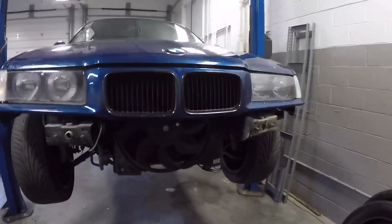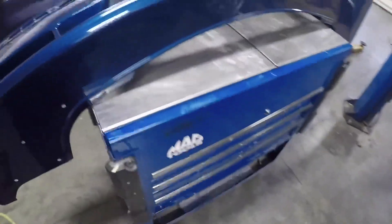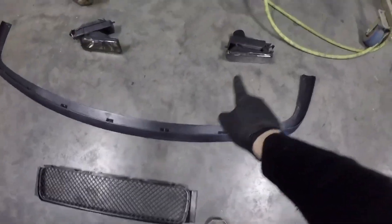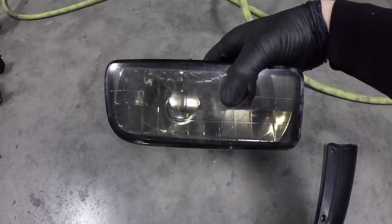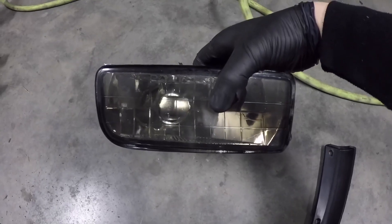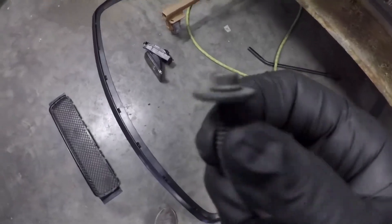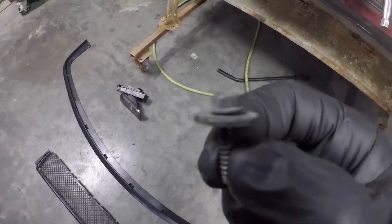This is how the car has been driven around for the past few days. This ugly-looking front end is about to be transformed to something a lot better with this new bumper — look at that paint job. On the new bumper I'm going to fit a new grille, new lip, and some halogens. These are tinted — I'll run them for a few weeks and maybe change them to brighter ones. I'm going to start with the lip, screwing it in using these fasteners — there should be 11 of them — so I'm going to get to drilling holes in the bumper.